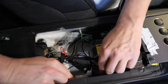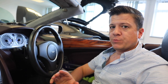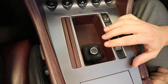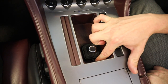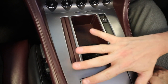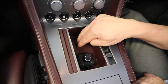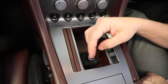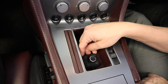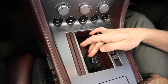Inside the cabin we have a couple of switches to place. The first one is going to be the CarPlay controller, which we have located right here. The lead for it is pressed in between the bottom and the side of this little cubby. To get to that, all you have to do is take out this panel — which is going to be out anyway for this installation. Underneath are some screws that you release so that this bottom piece disconnects. You put the lead through and then bolt it back together. There's a sticky pad on the back side, so it just gets pushed into place and will stay nice and secure.